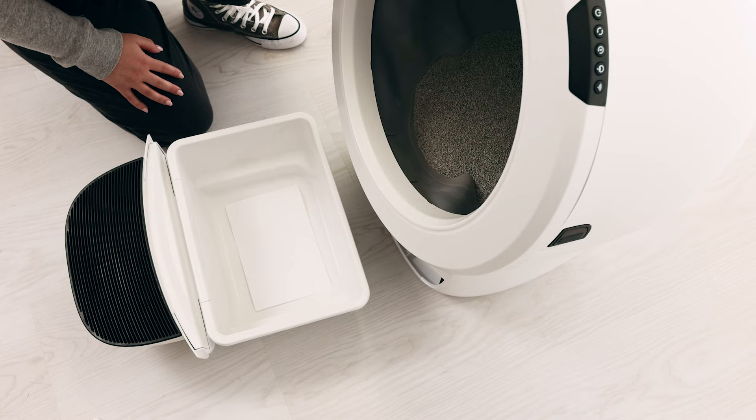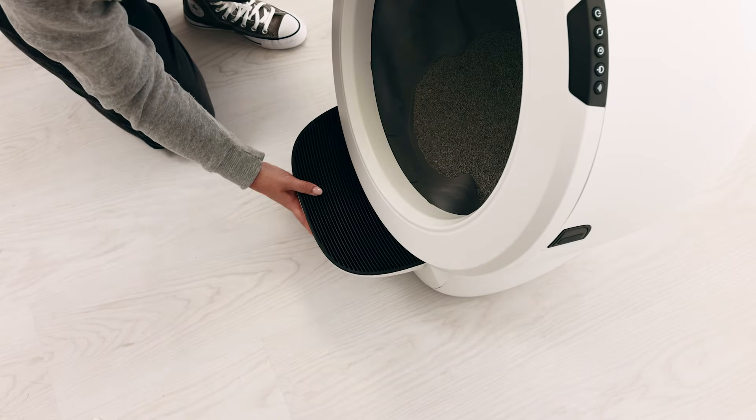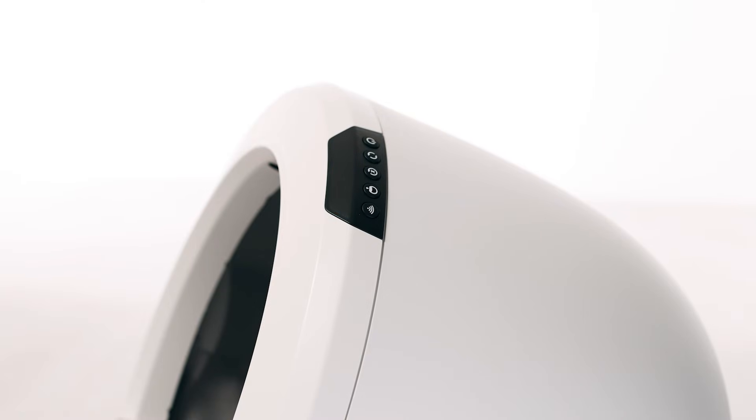Make sure the paper is plain white and does not have a pattern. Also, make sure that it will lay flat on the bottom of the drawer. Insert the waste drawer again — do not add a waste drawer liner yet. Next, press the power button to turn the Litter-Robot 4 off. Do not unplug the unit.